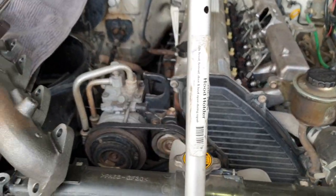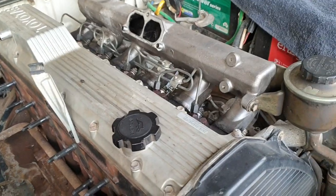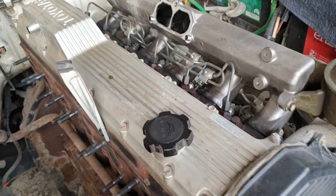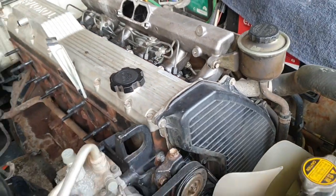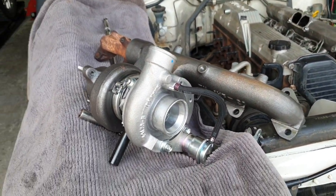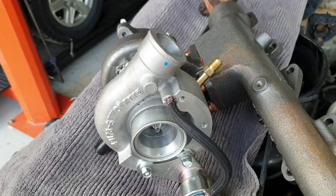Now of course the problem is getting air. You can see you've got a couple of ports over there and a real square-looking manifold, probably not really accustomed to getting lots of airflow in there. You might even say it's a little bit leaner in the middle ports and a bit richer up the end ports. So we put on a turbocharger, and the turbocharger of course supplies air to the engine — it does the work. The engine no longer has to suck for the air.